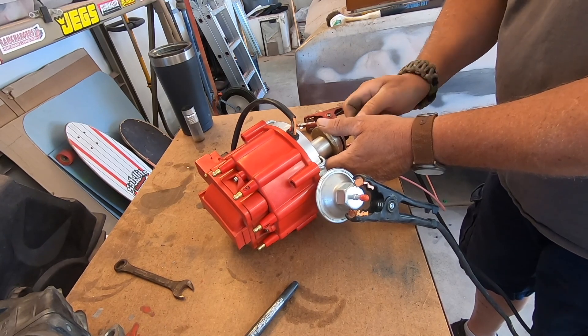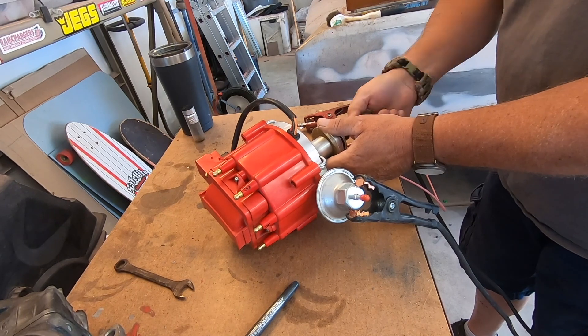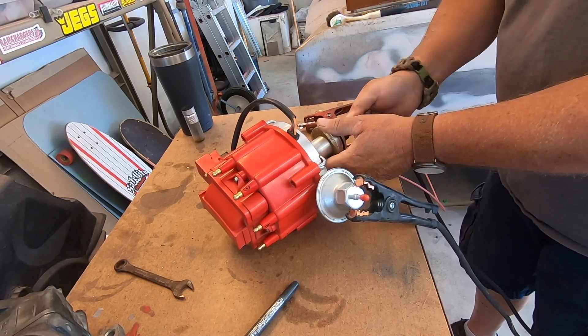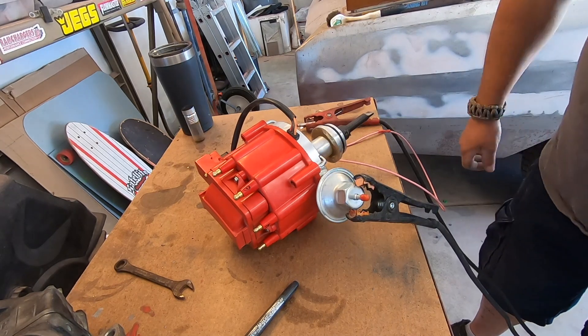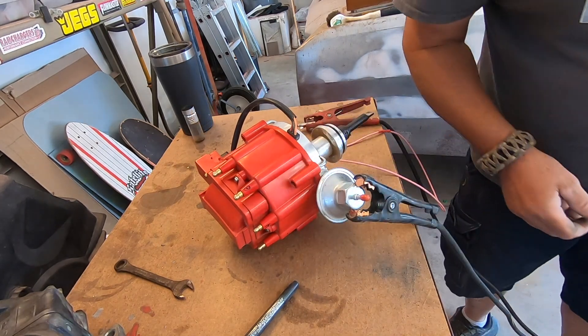You can hear it's not snapping now, but if I speed up a little bit... it's intermittent. So I think maybe that coil's bad. Probably the easiest way to find out is to go grab one that I know is good. At the very least, replace the cap and rotor and see if things improve. Let's go take a look.